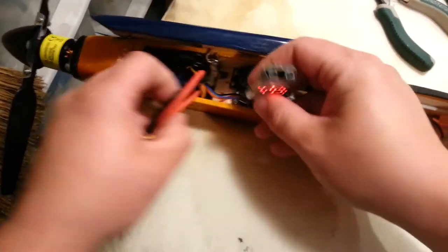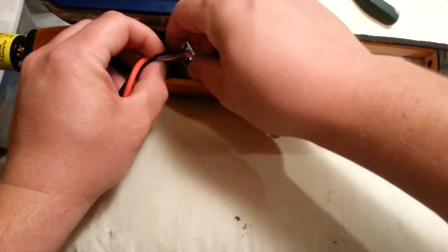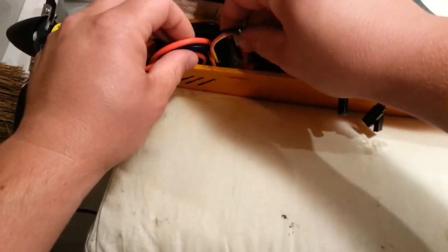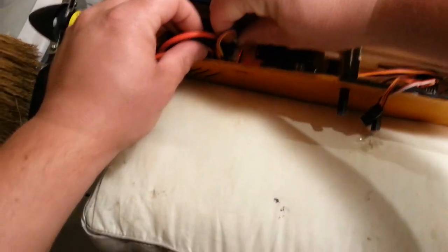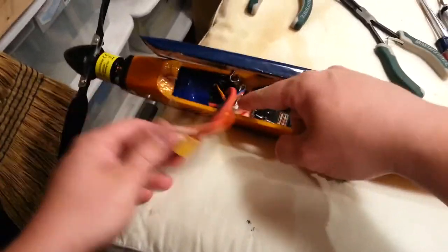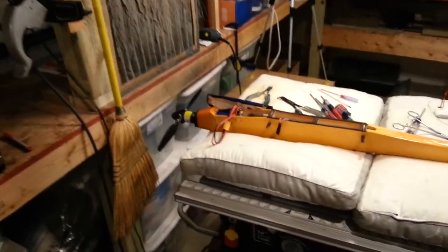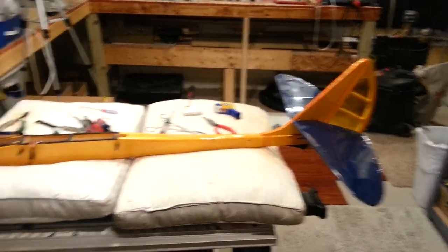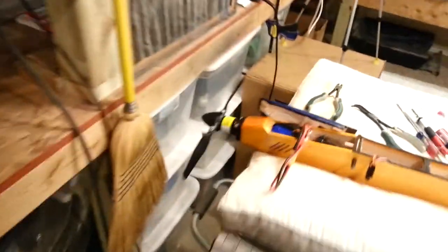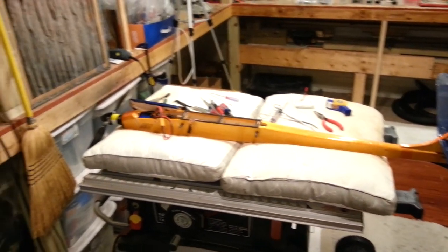I hope I didn't shoot myself in the foot with this 50 amp ESC, because right now I don't know where the heck I'm going to fit everything. Let's try stuffing this in here — we'll stuff that down. I'm not a big fan of having pins sticking up because it's not inconceivable that they could pierce through and short something. Anyway, I'm going to play with this for a while and hopefully come up with an awesome solution — hopefully it doesn't mean putting back in the 40 amp ESC. Then I will get you guys a flight video. Thanks a lot for watching — don't forget to like and subscribe.